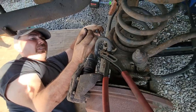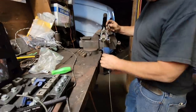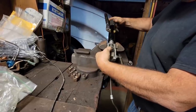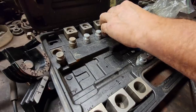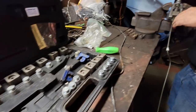I'm using epoxy-coated steel line because that's what's already on it and I like things to match. Sometimes I use that nickel-copper mix. The first thing is I'm using my hydraulic flaring tool made by MasterCool. It'll do 3/16ths, quarter, 3/8ths, half - it'll do push-to-connect fittings for GM and bubble flares. Right now we're using 3/16ths line.